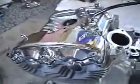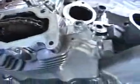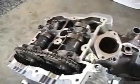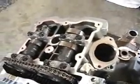I've now loosened all the bolts on the cam covers and the head covers on both sides. Once they're loose, you can just lift them off — that will expose your chains. The cover comes off right with that. Be careful of your gaskets; you don't want to rip any of them. Lay them straight off to the sides so you know where they go. This is the top where the timing chain comes over the cams, and your cams are seated in the top of the heads — front and rear. Everything looks nice and clean.